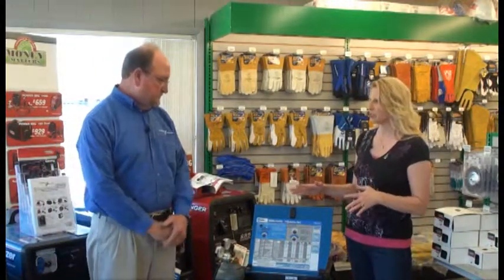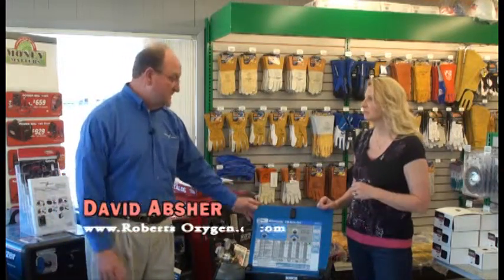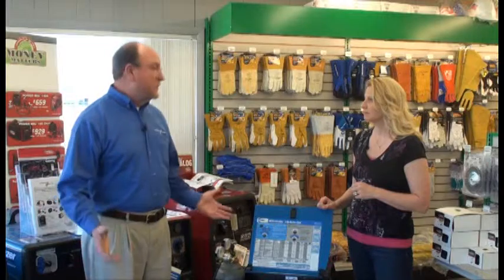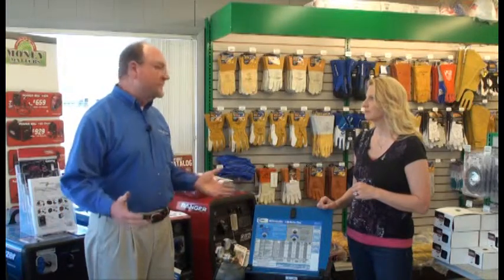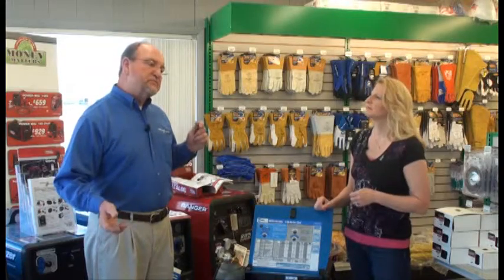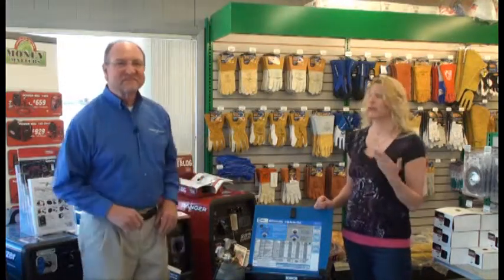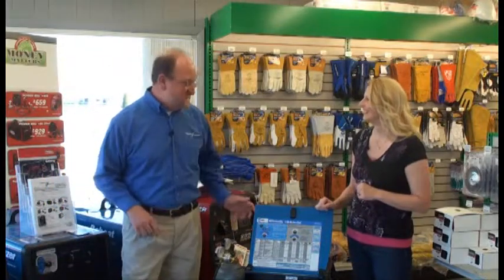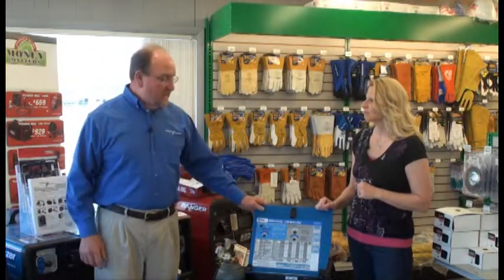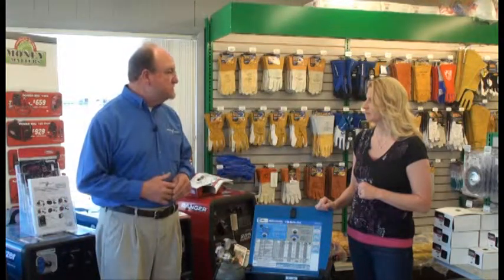There are three different kinds of welding. The most common is MIG welding, which is wire welding. Then there's TIG welding, which requires a little more skill level — two-hand coordination instead of one. The MIG is what we'll predominantly talk about because that's what 95% of your restoration guys use.